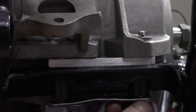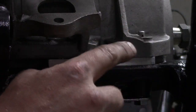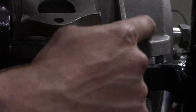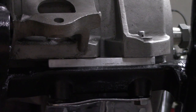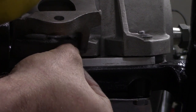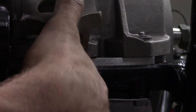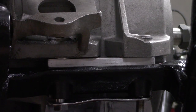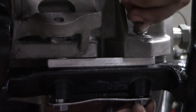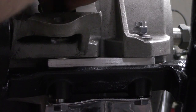This Colony kit is for a flathead or knucklehead motor, and in those frames you wouldn't need this plate, so actually these front bolts are going to end up being too short. I'll loosen the rear motor mounts back up and just pry up so I can slide my shims in here. Got that bolt through, put the captured nut down in there.